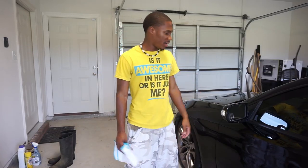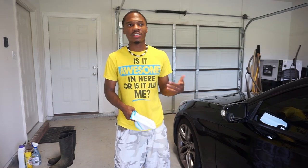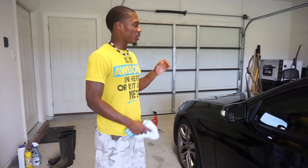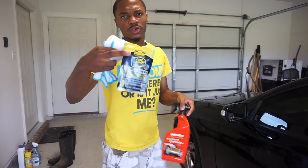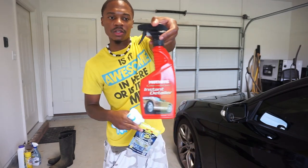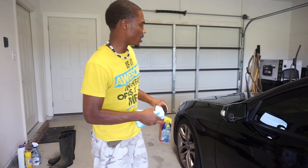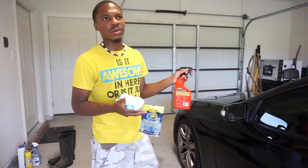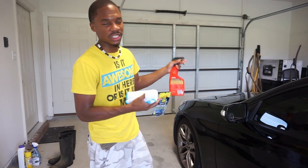I finally have my car in the garage. It actually stopped raining, so it's pretty dry out there, but I didn't want debris flying around to settle on the car. Now that it's in here I'm gonna start with the actual detailing — the first thing will be clay barring. I have my clay bar here; all you do is tear a small piece off for one application. I also have Mother's Quick Detail spray and a microfiber towel. I'll saturate the area, clay bar it, then dry it off, and I'll show you the before and after on each side of the hood.